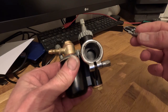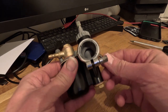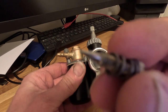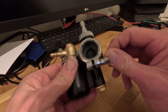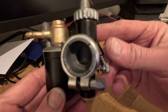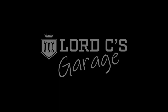Finally, we just need to fit the two valves in the side. The one with the flat top goes in the sloping hole at the top, and then the needle valve with the point on it goes in the side there. I've also fitted the clamp so it can clamp back to the body of the engine. So there you go — one carb all ready to go! I hope you enjoyed the video. Hopefully next video we'll be on to building either the engine or the gearbox. See you soon, bye!